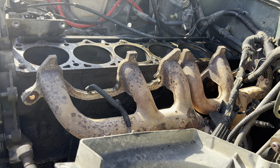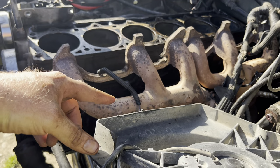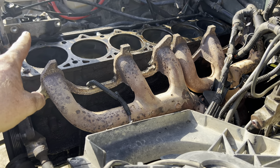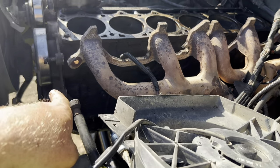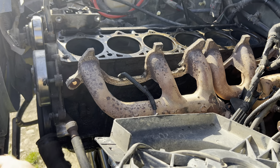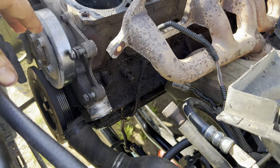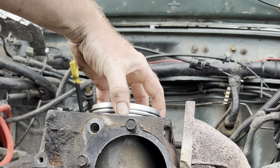I went ahead and skipped the teardown video because if you've ever put a manifold gasket on these, you basically tear it down the same way — you just take your intake off, all the stuff off the top, the valve cover, your power steering pump, all that good stuff. Then take your two bolts where your AC compressor bolts — that's my alternator though, I did the alternator relocation. Pop your head off — pretty self-explanatory. I'm going to take the water pump off, the AC pump bracket, the fan, harmonic balancer, radiator, put a new timing chain in — all that good stuff. Make sure you take your oil pan off. Take your rod caps off, then take a soft screwdriver handle and punch the piston up through. Once it gets up so far, you can pull it right out.